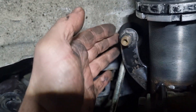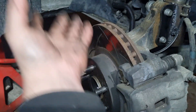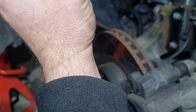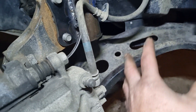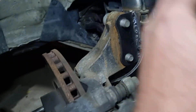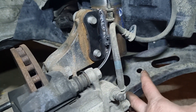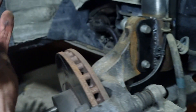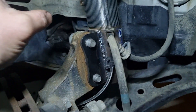I've installed the coilover here without the spring. What I'm checking here is clearance for things like the sway bar — make sure that doesn't rub on the body, seems all good. I'm going to put a wheel on it and move it up and down in the wheel well to make sure the wheel doesn't touch anything. The other important thing is to make sure that all the ball joints don't overextend and bind up. Right now it's on full droop which is a fair bit more than the factory car, so those rubber bushes are stressed a bit further, but the ball joint isn't maxed out so that's okay.